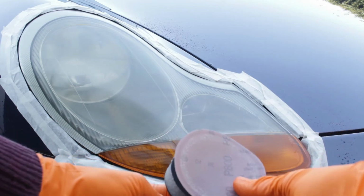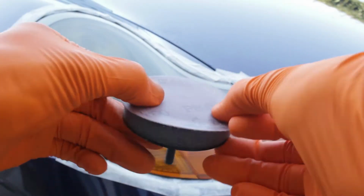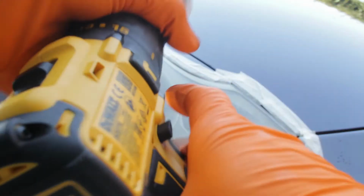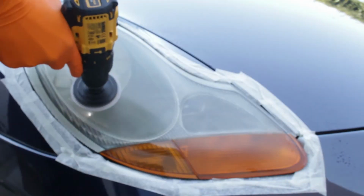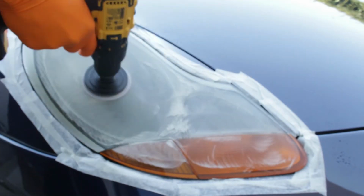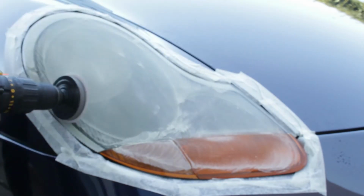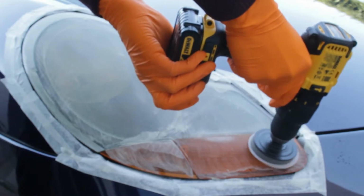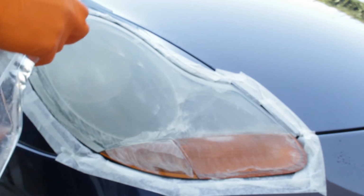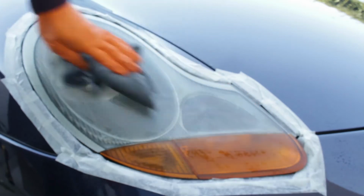This drill attachment and sandpaper comes with the kit linked in the description. Just attach it to your drill and turn the drill on and move it over your headlight. Don't stay in one place for too long, you don't want to melt the headlight. And it helps to spray it with water every so often, because this helps to remove the dust, which will mean your sandpaper will last longer.